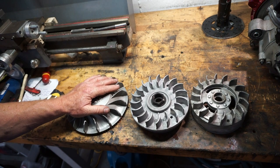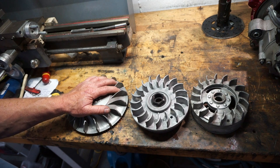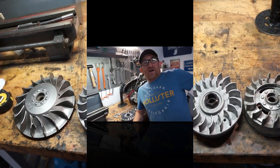So that's why the P200E is the cart horse of Europe - nothing to do with mechanical excellence. The bearings aren't any better, the crank's no better, the pistons are no better. Mechanically it's not that much difference, but the cooling is immensely more efficient. And that's what it is. I love Lambrettas, but bloody hate these Vespas - damn reliable buggers. Why can't companies get it right? We're paying them big money for kits and flywheels and all this stuff, and they just ain't got it right. None of them. I'm shocked.